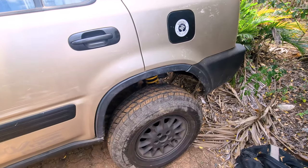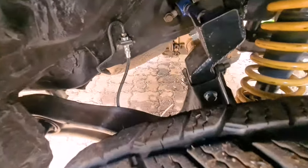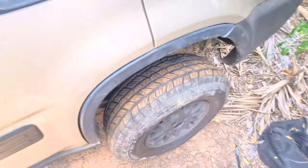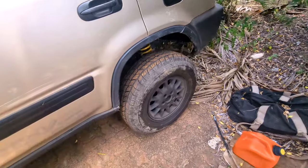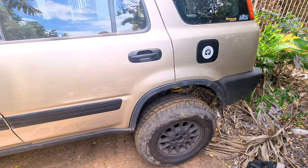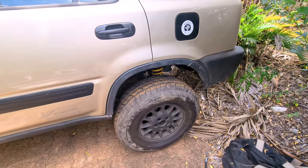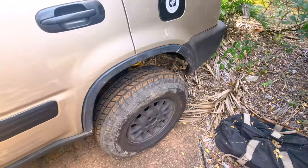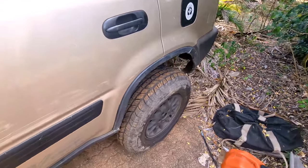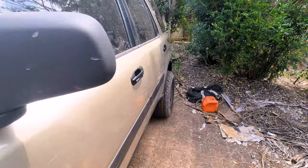When it came time to put the wheels back on and get those brakes bled, I'd never actually bled brakes in my life. I got the hoses connected up, got a cheap bleeder kit, and with that upright bleeder it was easy enough to do a gravity-fed system — no air in the brakes. First ever time bleeding brakes, by myself, took maybe 10–15 minutes. I'm very, very glad I did the upright bleeder method; I would have been kicking myself trying to bleed them solo with the bleeder upside down.